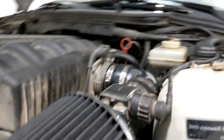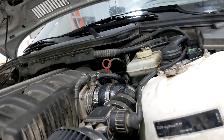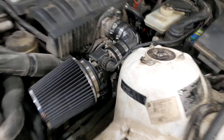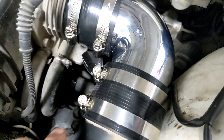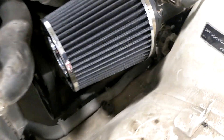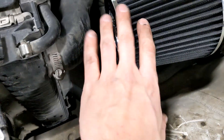I got it. To get the air filter down out of the way, I'm going to take the MAF and spin it just a little bit. I need to loosen this back up and then tighten it once everything is aligned. That looks so much better than that piece of crap from eBay. The wire is now off the metal, and the band is touching the metal so it's not going to rub the silicone. Everything's tight and clean looking. The air filter's not touching anything — it's got some space from the alternator, which gets hot on these cars.